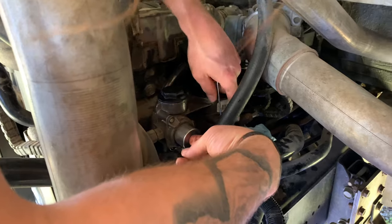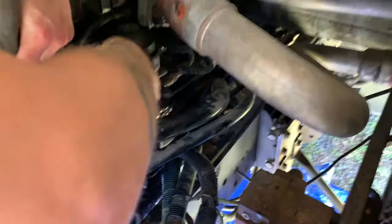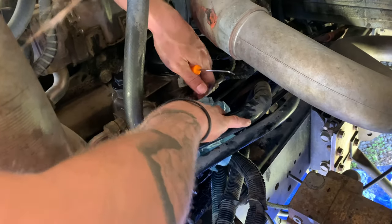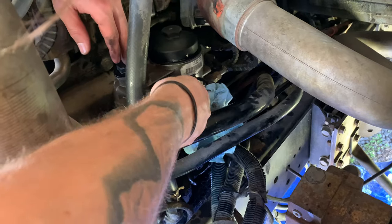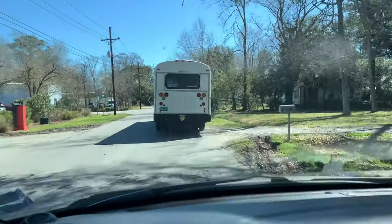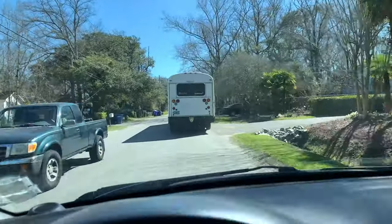Shane is now bleeding the bleeder valve. It's right in front — you're just putting some rags underneath, using that hook tool to bleed it out and catch the fuel that comes out. Then he has to do that other Schroeder valve to get the air out. Then we add more diesel with the kill-them algae treatment and pray to God our bus starts. We got the bus running! We're taking it for a 15 to 20-minute drive to get all the juices flowing and get it happy again.